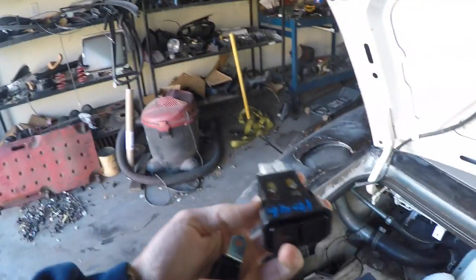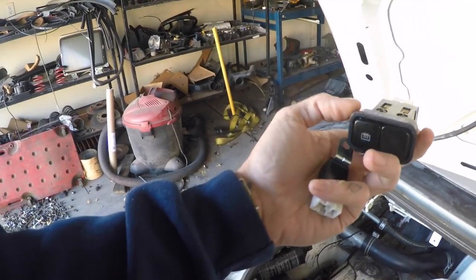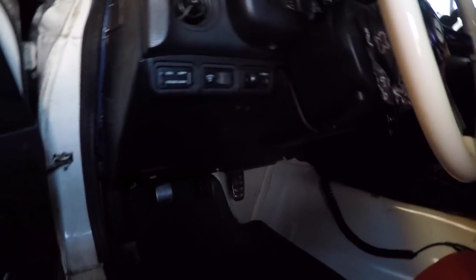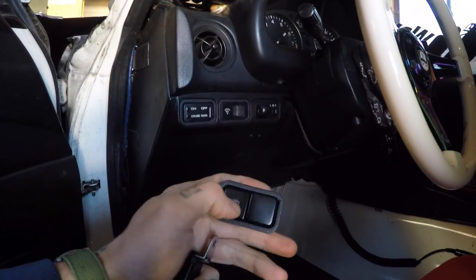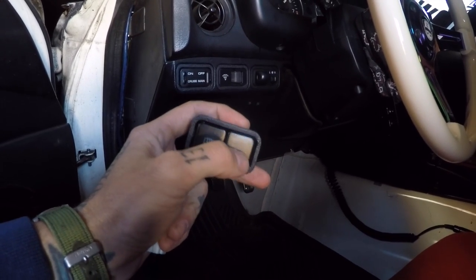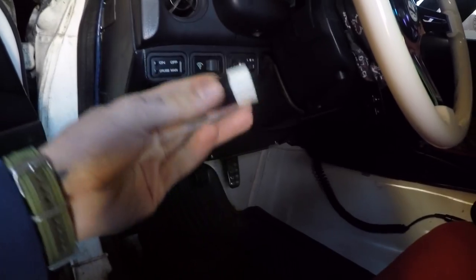What you're going to need: first, go on eBay or somewhere and buy this multi-switch that goes on the left-hand side of the dash. I'm going to replace one of these switches — probably going to remove the electric mirror control since I'm going with aftermarket mirrors anyway. I got just the defrost switch, but they also have one that's a defrost and a stock fog light switch. Either will work for the defroster, and if you get the combo one you can wire in fog lights on the dash. Once you have the switch, you also need to order a main relay.